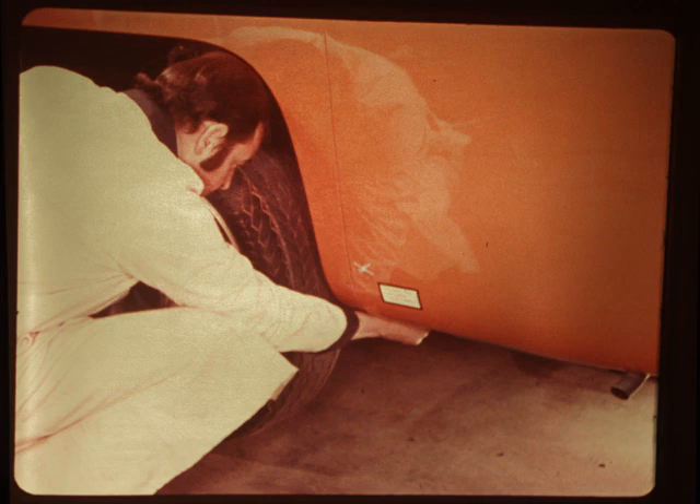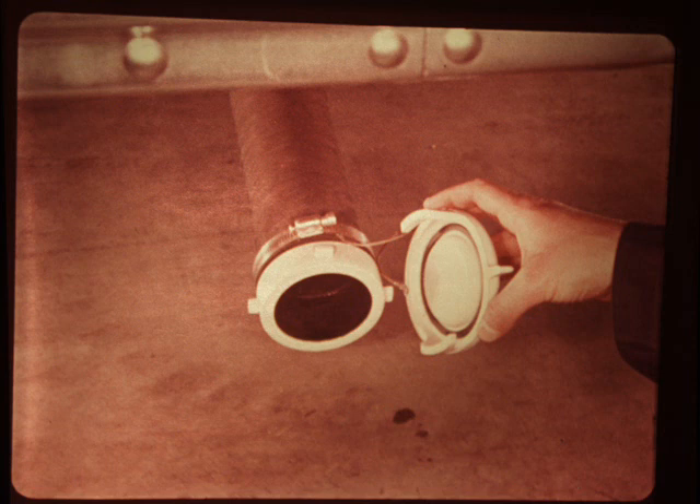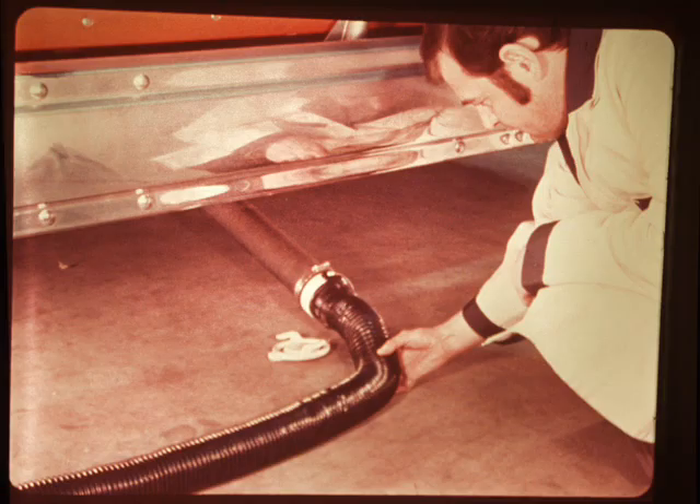At the rear of the motorhome is the valve for emptying the holding tank. Before you start to empty the tank, be sure that the holding tank valve just behind the left rear tandem tire is closed, otherwise the contents could spill on your hands. Then remove the dump hose extension, which is retained to a bracket near the left energy absorbing piston, by rotating the hose adapter counterclockwise from the bracket. Pull out the dump hose from the bracket mounted to the center of the rear crossmember, remove the dust cap, and connect the dump hose and dump hose extension by rotating the adapter clockwise. After you put the hose into a sanitary dumping station opening, check to see that there are no sags in the hose which would prevent complete dumping.